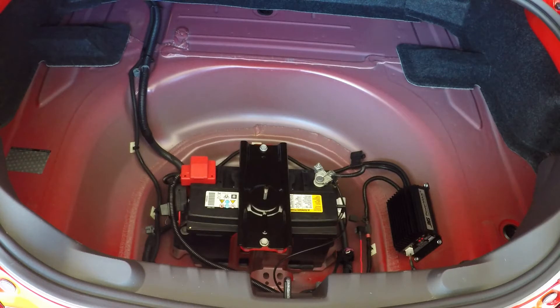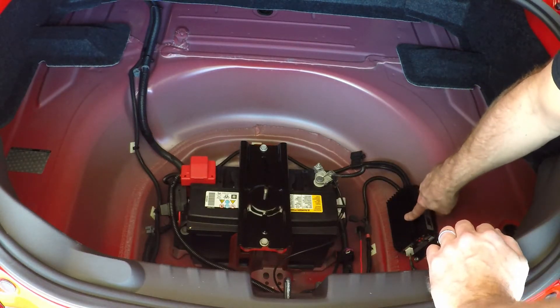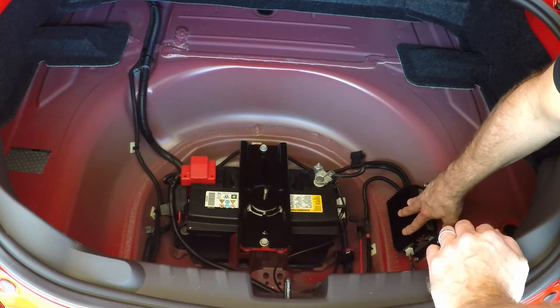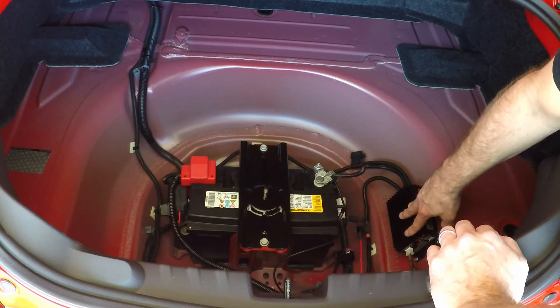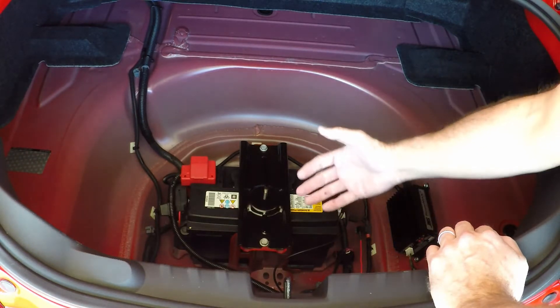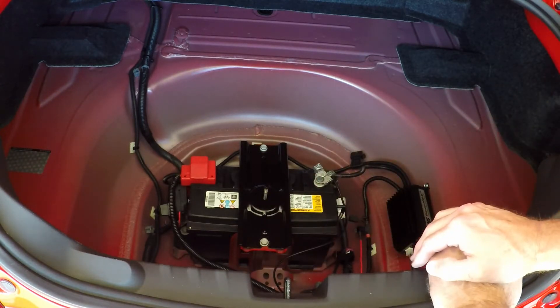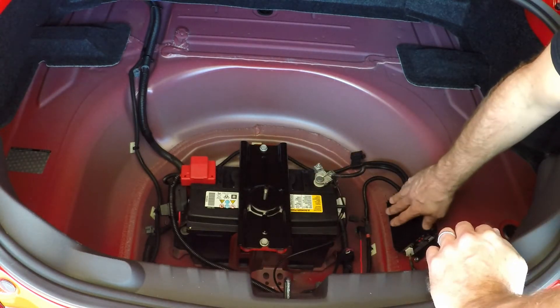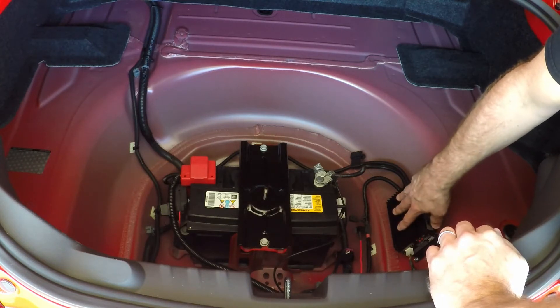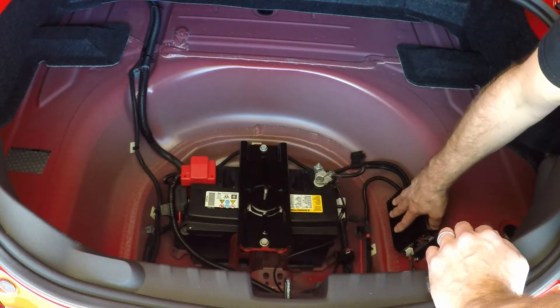If it's your first time here, check out my video section — I've got tons of stuff on this car you might find interesting. So today I'm working on the boost pump, which is this right here. If you don't know what a boost pump is, this raises the voltage to the fuel system control module, which raises the voltage to the fuel pump, delivering more fuel to the engine. Before this, I was maxing out — I was leaning out at redline. It's kind of borderline, so I needed to get one of these.